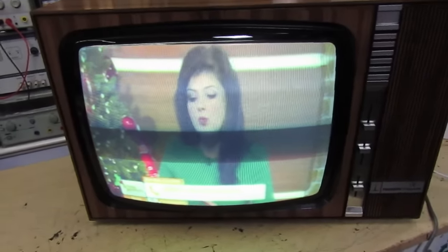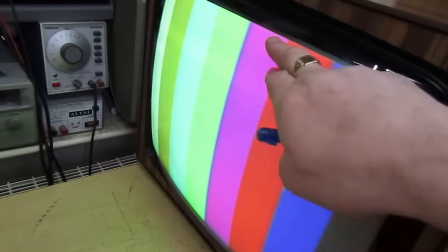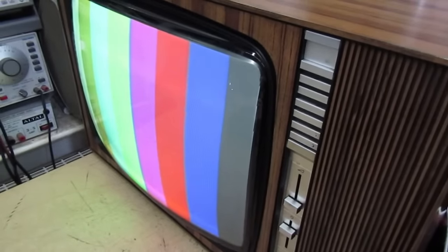That picture is absolutely terrible. As for the frame fault, I'd imagine it's a capacitor dried up in the frame - because the more I leave it on the better it's getting. There's a faint bar and a little non-linearity, but not as bad as when we first turned it on. I do have a brand new tube in the loft - I'm pretty sure it's for this model; it's still in its box, possibly a Mullard Colour X re-gun with bonded-on scan coils. Re-guns weren't the best tubes at the best of times, but that's for another day.